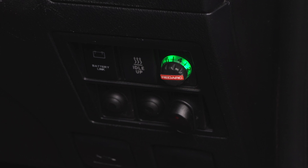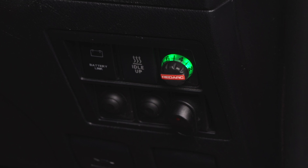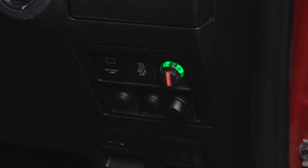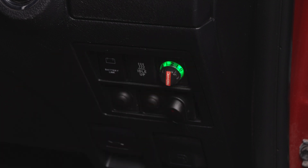In off-road mode, the TowPro remote will glow green and apply the trailer brakes to the level set on the remote, regardless of how hard the vehicle brakes are applied. This mode is designed for towing where the driver requires more control, like beach towing. If you brake hard on the soft sand, the vehicle will bite into the sand, and if the trailer does the same, you could end up anchored there. By dialling back the braking force using the manual off-road mode, you can brake the vehicle and the trailer will glide to a stop on top of the sand.